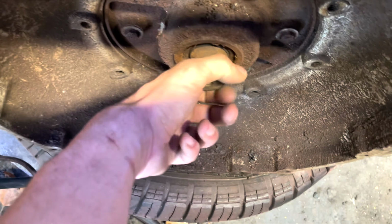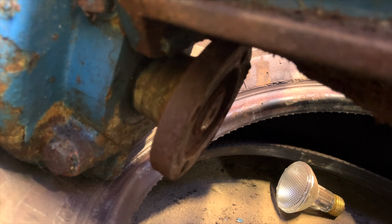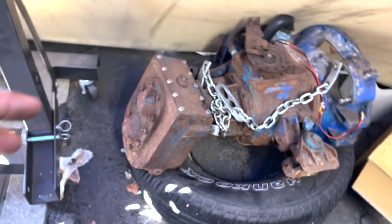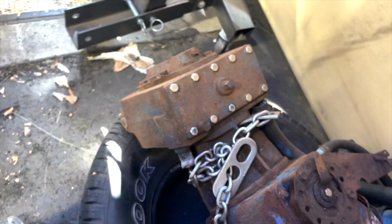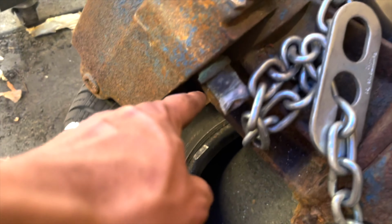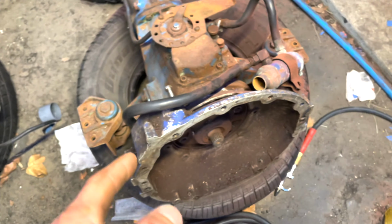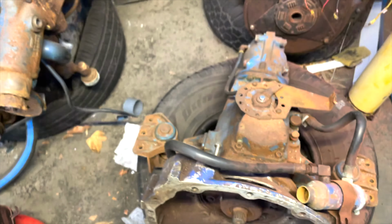If I go to the right, the drive goes to the left. And if I go to the left, the drive goes to the right. Okay? And it's the exact same thing on this guy. So I don't understand why, if they're the same transmissions, this one has this giant backside. That doesn't make sense to me. And the cooling hoses, for instance, would go one into here, and I guess exit out of here, so it would be cooling this whole section, while the cooling on this transmission is in a completely different location. It's just routed completely different. So what's going on here, guys?